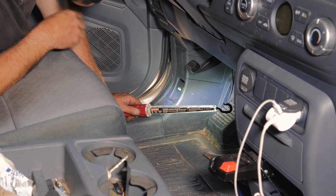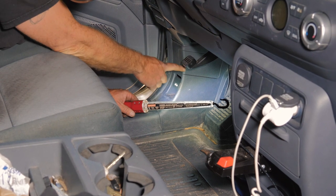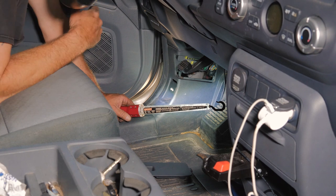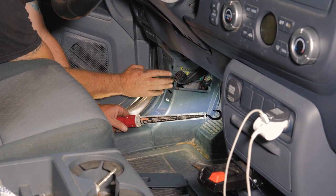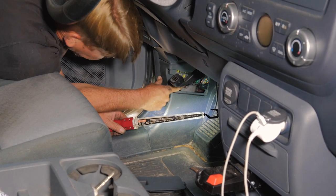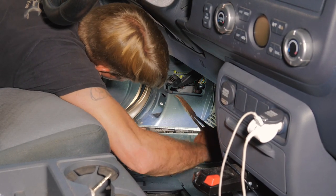We're ready to prime the new oil pump. So what we want to remove is the ignition fuse so that it doesn't get any spark, so we can just crank the engine. All right, so we're underneath on the left side of the dash. Fuse number 2 is 15. That's going to be right here. We'll go ahead and remove that fuse.